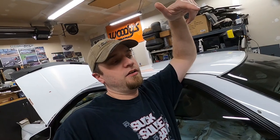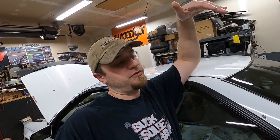So I tested it on my driveway. My driveway is pretty damn steep. So what I did was I hit that hydraulic parking brake just like you would for a typical line lock in the front. Still put it in gear because I didn't trust it. But I tried it a couple days later and it was still good. I pushed the clutch in and it went nowhere.